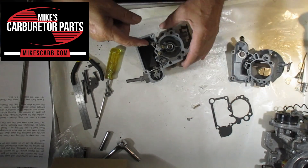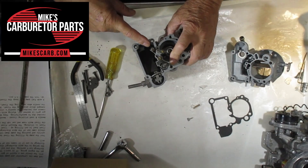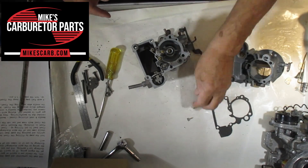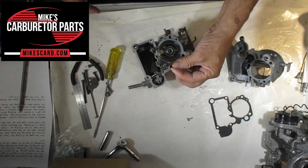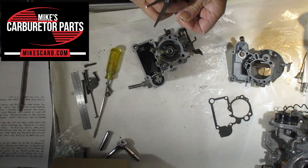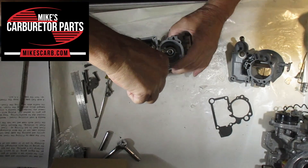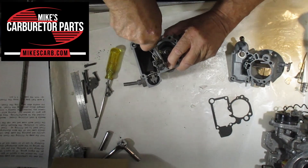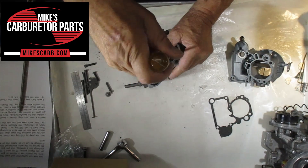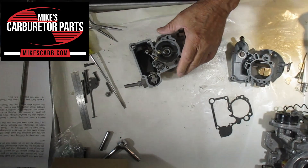We talked about gas leaking out after a hot run. One thing you might do is put the check ball in, get a little drift punch, and tap it lightly to help build a trough for that check ball to seal — it may not be sealing properly. The check balls are generally pretty hard, stainless steel. Then you put your T in, and you can stake it a little bit by taking a chisel and tapping it there, but basically it's going to stay in there anyway.